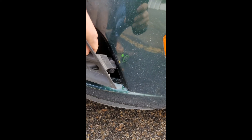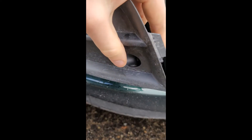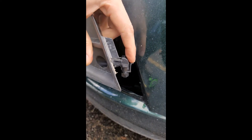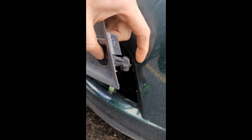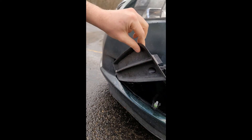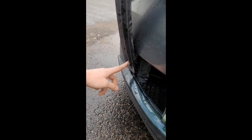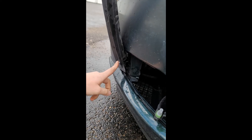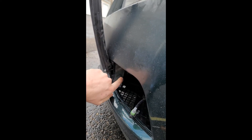The last thing you've got to do is disconnect the outside air temperature sensor that is right there. On the back side, this clip is one of the easiest on the car — you just take this tab, push it off, and there's your sensor. Yours won't swing up like mine; like I said, mine broke off so I ended up running a screw through it with a nut on the back side.